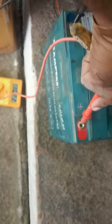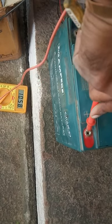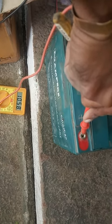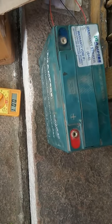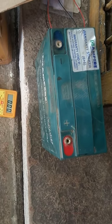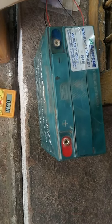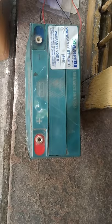That is very essential — the life of the battery is important. This bulged battery shows around 10.5V, as you can see on the meter. This is the only battery among the 4 that shows less than 12V. The other batteries show 12V. But still, replacing all the batteries together is very important for the vehicle.